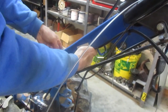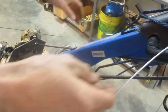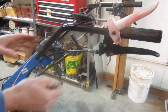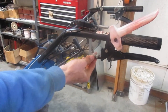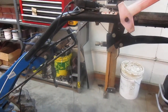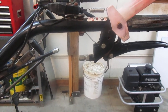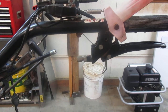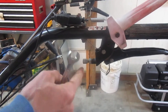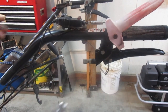Get the sheath threaded through. This end plugs into the adjustment screw, which is for adjusting the tension of the clutch cable — it's the easiest way to adjust the tension. The other way to adjust tension is with the cable clamp at the end of the cable, but typically the adjustment screw is the much easier way because it's a very fine adjustment that doesn't bugger up the cable every time you move it.